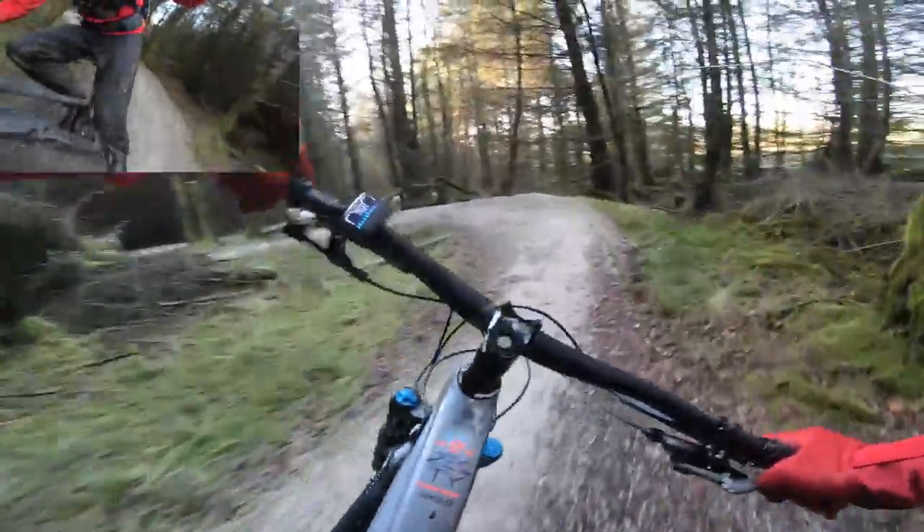Even though it's got the simpler grip damper, control is really really good, especially with that bit of extra sprung-to-unsprung ratio in its favour. You've got 3C compound 2.5-inch Maxxis tyres on 35mm rims, so tons of support and grip. One thing I would say is it comes set up very much for maximum comfort and plushy traction — with both shock and fork fully open you're going to blow through the travel pretty easily.